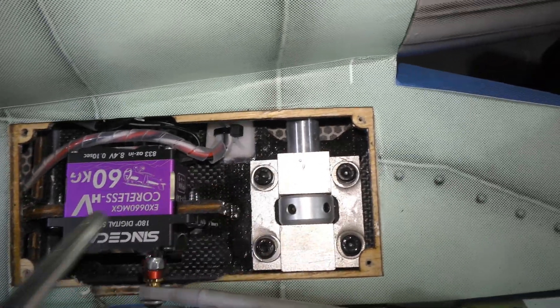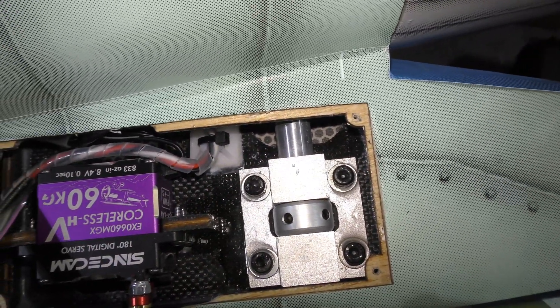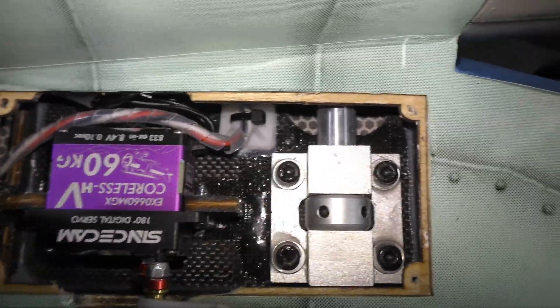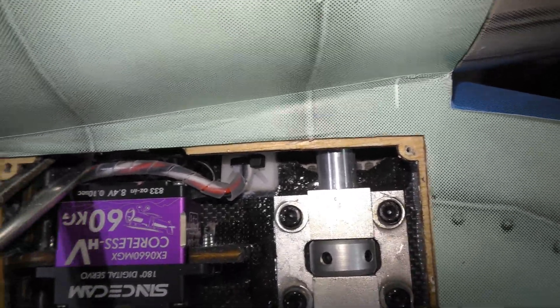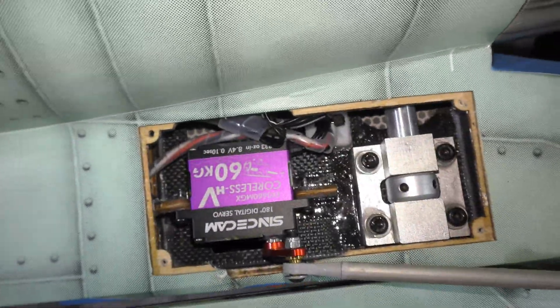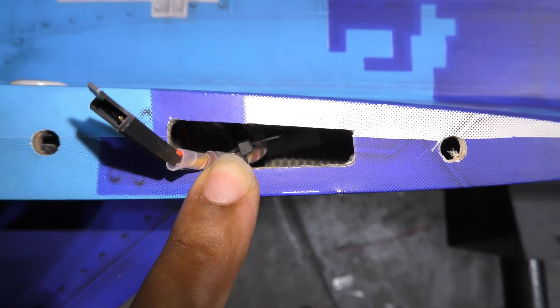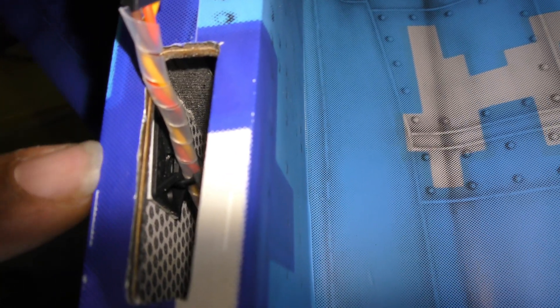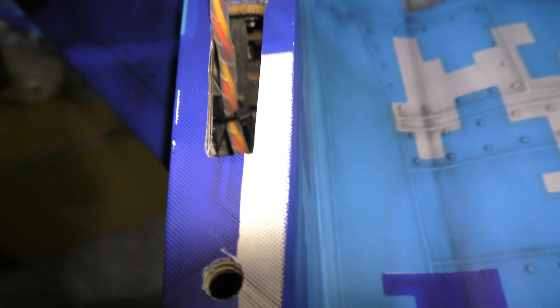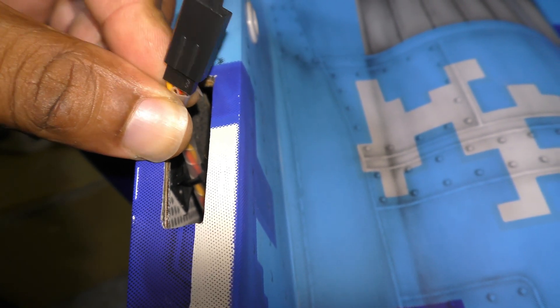At the tail, you can see that I added this clip, and here's the harness that comes all the way from the front of the jet. You can see it's been wire wrapped in spiral wrap just for chafe protection. That whole connection comes into this spot, and as you can see, I just coiled up my servo wire. So all that needs to change if the servo is busted is right here in the back. Here is the rudder side, and I have a clip secured to hold the rudder harness in place. You need that wrap to protect that servo cable from chafing.